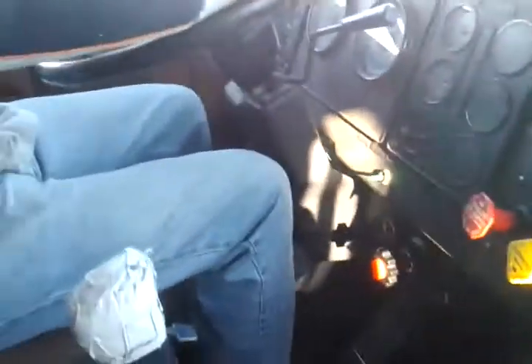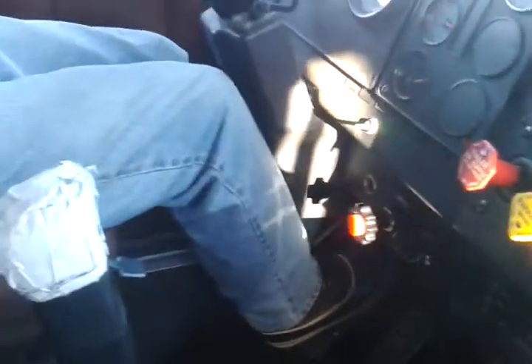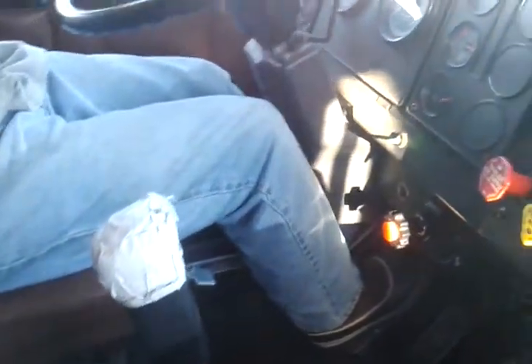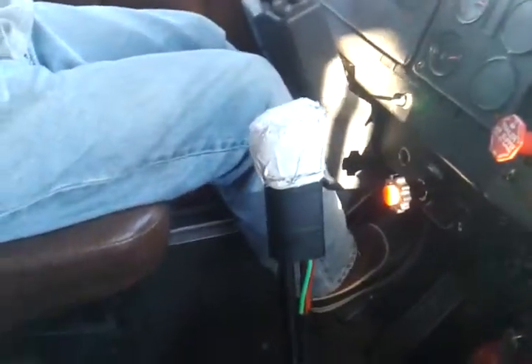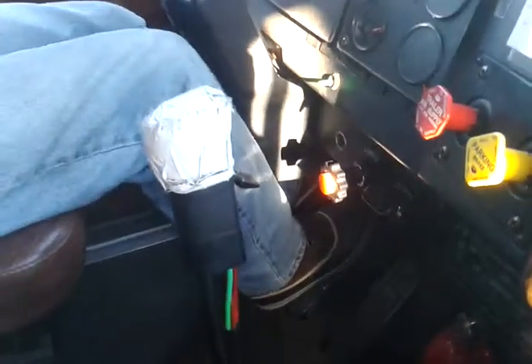Give that clutch leg a big movement. Go ahead — step on the clutch, use your brake, bring it to a stop. Put it in first — alright, foot off the brake, engage the clutch.